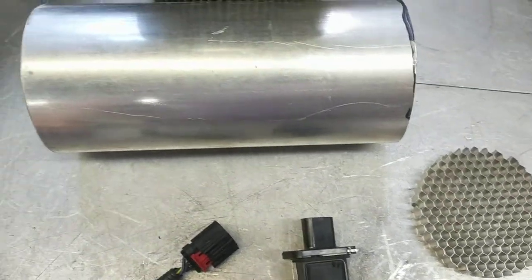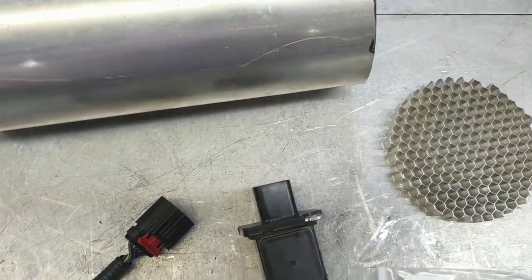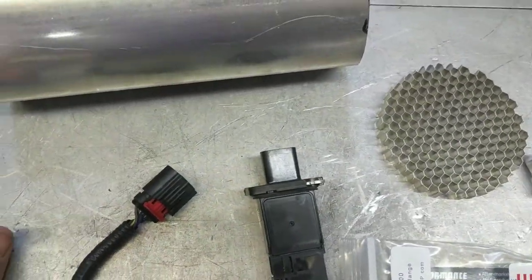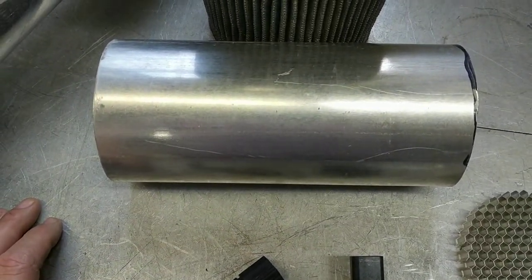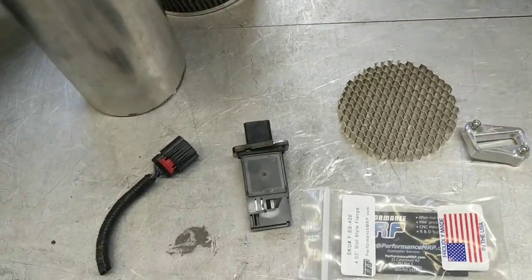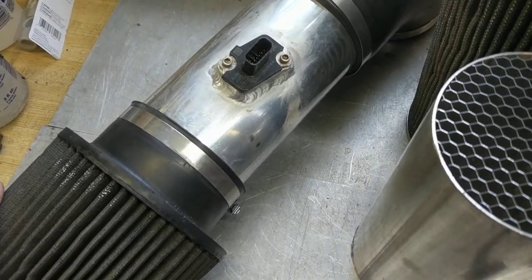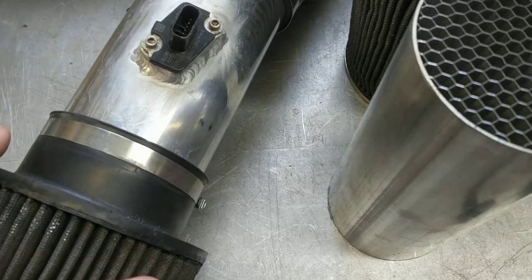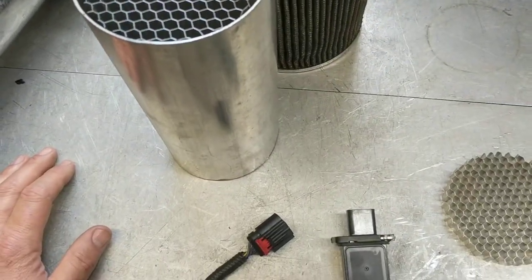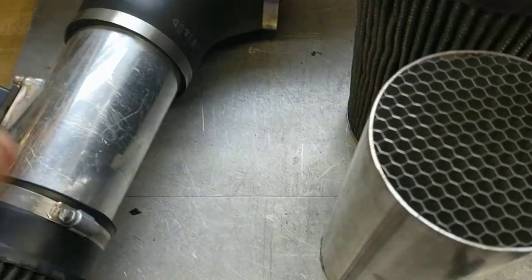It's just a honeycomb deal — it's got to be a couple inches ahead of the meter. They also sell a complete mass air meter body that has the mount and the air straightener built in, so all you have to do is get the tubing to fit and a slot meter. It's about 95 bucks, which might sound pricey, but you don't have to have anything welded. If you don't have access to welding, it's a good way to go. Of course, running a slot meter you're gonna have to get a tune, but that's not really hard to do if you get your own tuner.